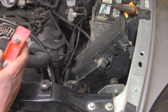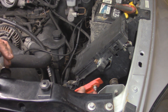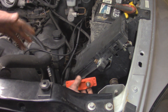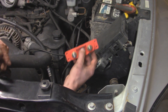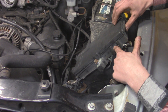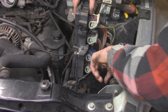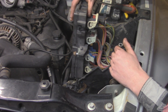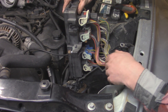Before putting the new cables in, I'm going to install the fuse block that will replace our fusible link on the alternator. I decided to mount it on the side of the fuse box by drilling a couple of holes and putting nuts on the back side. There are four holes on the fuse block but I'm just going to use two — that should be strong enough. To get on the back side of the fuse box there are two little clips on the top; push those in and the whole fuse box comes out. The plastic piece we're bolting to is not inside the fuse box, so we don't have to worry about water or damaging other wires. We'll drill the holes, bolt on the fuse block, and snap the fuse box back down.